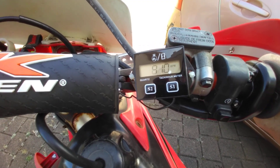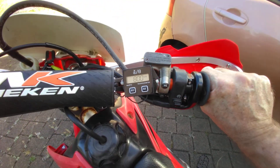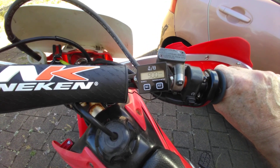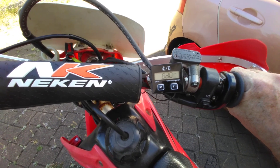Now I'll take the choke off because it's a bit too much choke, and just feather the choke back — work it back to 50% as she warms up. Then you should be able to ease the choke right into the open position again.